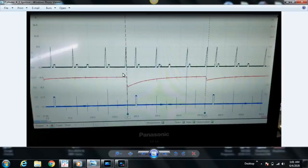In this case, we really weren't interested in getting true secondary ignition analysis or acquiring a really good waveform. We were mostly just going to compare this cylinder, which is cylinder number, I think it's 2, to 6, and 6 is the suspect coil and 2 is the non-suspect coil. So usually I'll get a waveform on the good cylinder compared to the bad cylinder, but I do so in a much better way, generally speaking. Now with Pico, there's some things with regard to secondary ignition I want to talk about for best practice, or at least best practices in my experience.